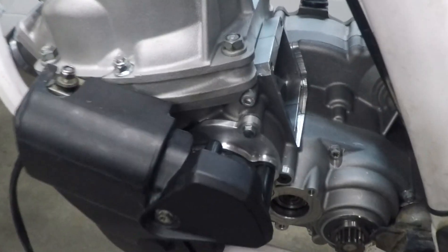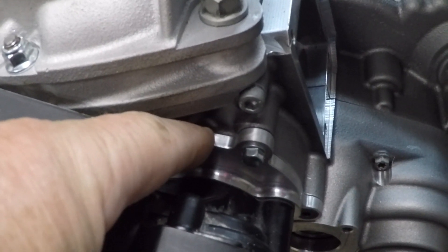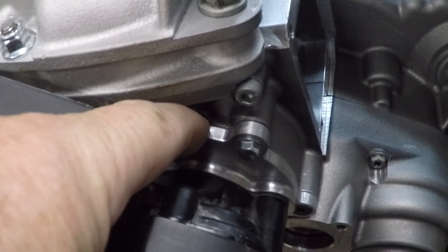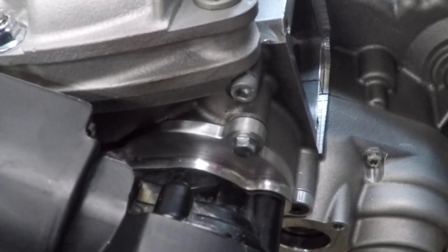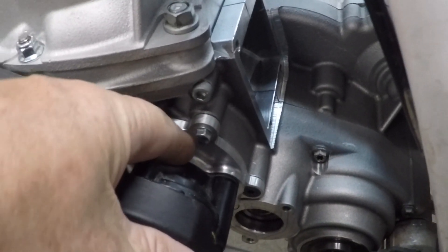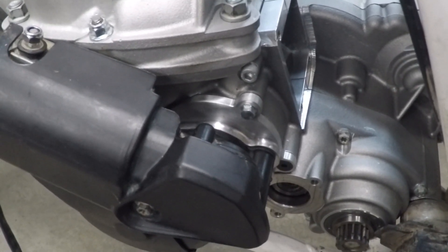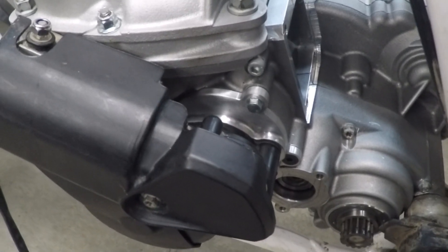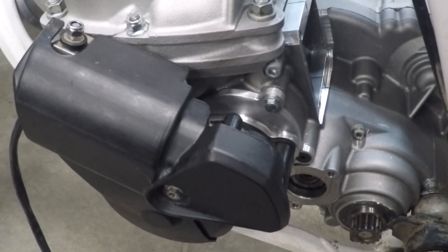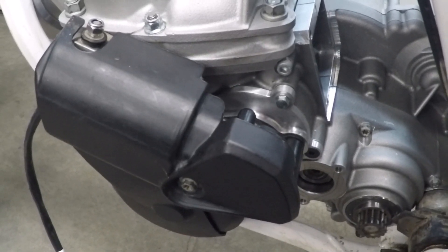Just so you can see it right here — here is the adapter ring to make use of the starter system from the donor bike. A nice feature of the starter system is the internal race in the bearing back here fits into a roller bearing in the countershaft balancer. So that little part that used to wear out all the time is now supported by a nice roller bearing inserted into the counter balancer.